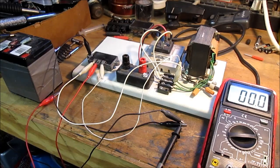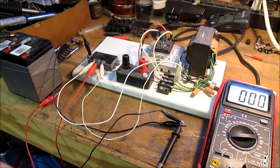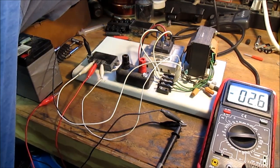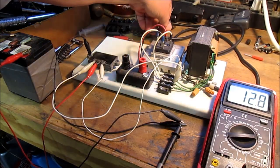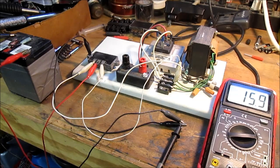After reviewing my video, I heard somebody pointing out that the regulator requires 12 volts from the tractor battery to actually operate. So I went and got a 12-volt battery. Right now, if I plug the regulator in, I get that negative 2 volts. So we'll unplug the AC, which is simulating the stator. Now I'm going to add 12 volts to it — I'm at 12.8 volts. Now I'll plug the AC in. Regulator's good — regulating at 15.9 volts. So I don't need a regulator. I'm glad I went through this test — saved me some money.